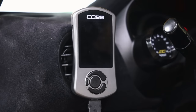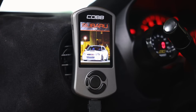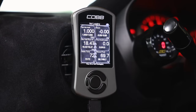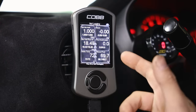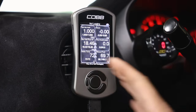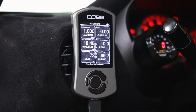Put the key in the ignition, turn it to the on position, and that's going to auto-start the access port. On my display I have six parameters pulled up - these are typically what I monitor when driving. On the top left I have my dynamic advanced multiplier, rear O2 sensor, intake temperature, boost, fine knock learn, and ethanol final content because this car is on E85.